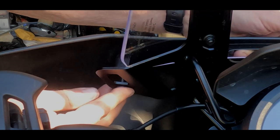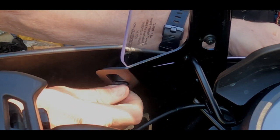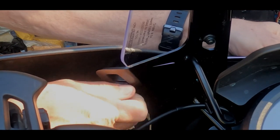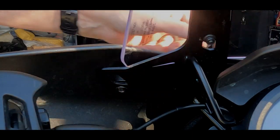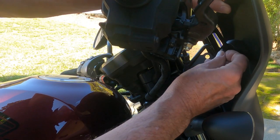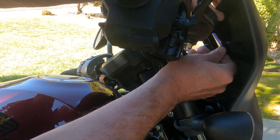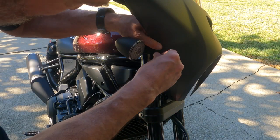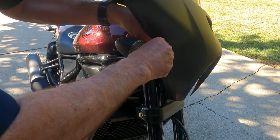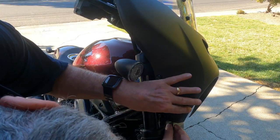The easiest way to install the Batwing is to attach the two well nuts on the inside of the Batwing first. Get one 5x16mm hex screw started. Use it to hold the Batwing in place while you line up the second hex screw. After these two screws are partly threaded, it will be easy to line up and thread the remaining four screws into their well nuts.